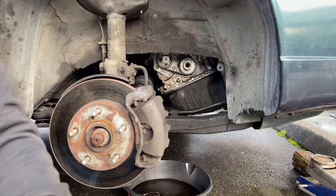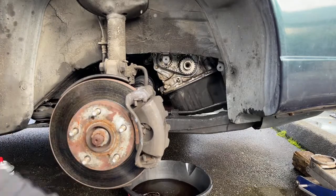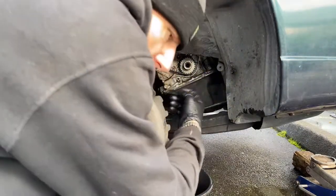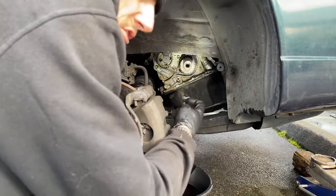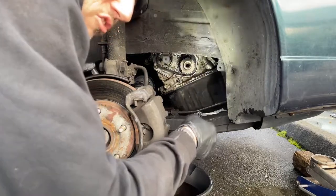I'll have a 6 gallon air compressor on board, and I'll put a 3 or 4,000 watt inverter so I can run 15 amps. But I'll still have a vacuum cleaner, air compressor. The vacuum is for cleaning out intake manifolds. When you're doing intake manifold gaskets, and you gotta clean out the valves and stuff, you make sure stuff doesn't go down into the engine. So. Does kinda look like she's coming from up higher. I don't know, is that?